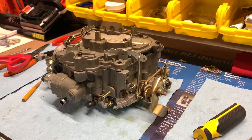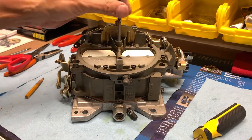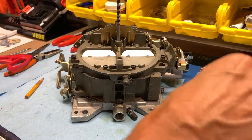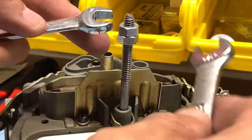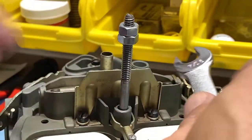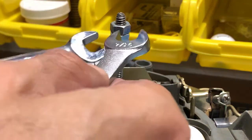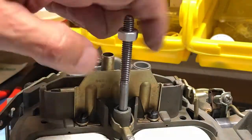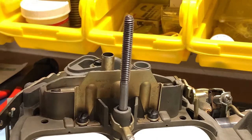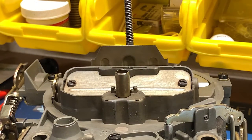It's a good thing to have a checklist. The last item is this threaded stud for the air cleaner assembly. To tighten this without mangling the threaded rod, I used two nuts tightened against each other — using the top one I can tighten this super tight without scarring the stud. Then you just loosen those two nuts and you're done. The carburetor is done! I have all my parts that I removed, cleaned and waiting to be reinstalled, and I don't have any leftover parts — which is a good thing.